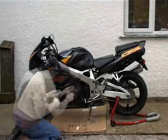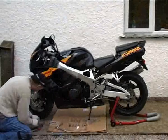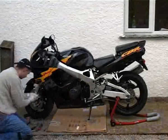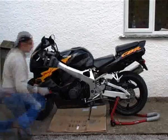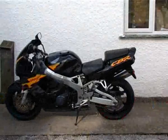When I'm putting the brake pads back in, I use copper grease on the pins, clips and the backs of pads to make sure everything works and slides as it should. I also make sure I put the pads in the right way round. There are a few final things we can do to finish off the bike if you've still got the energy.